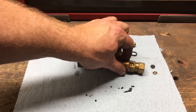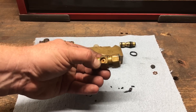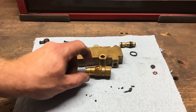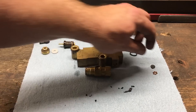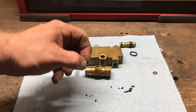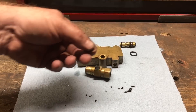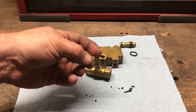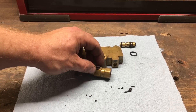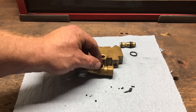Here's what we found — an adapter with some kind of relief. You guys see this little tiny hole? That little hole is where all the brake fluid was squirting out. The only thing sealing that hole was a rubber gasket — could be cork, but when I pinch it it feels like rubber — just a small gasket that sat down in that hole, held in by this little star washer. That star washer is all that locked that little pad down inside the hole.